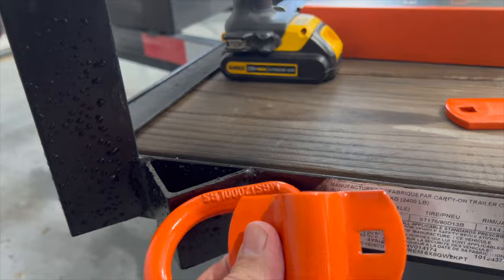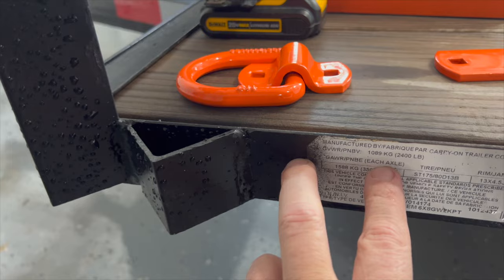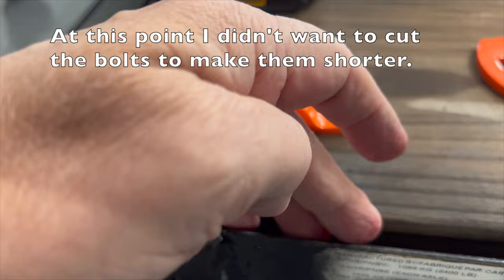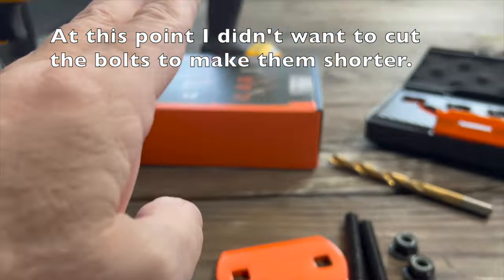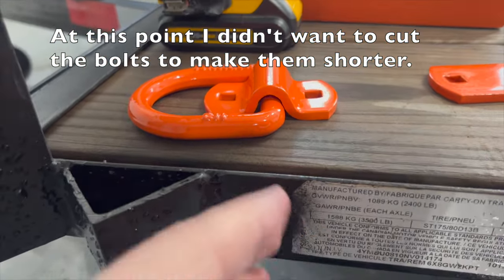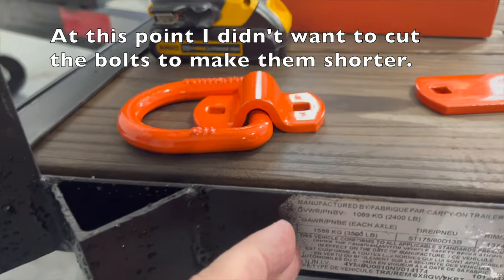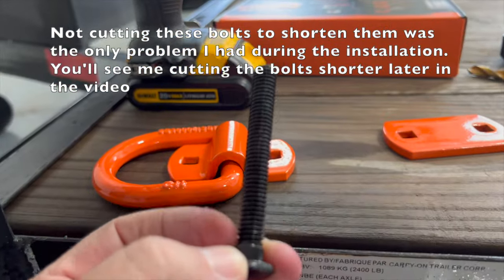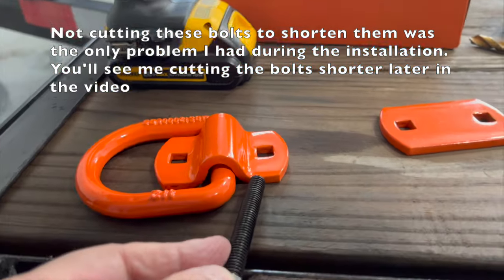Let's get started. So I'm gonna have to put 3/8 inch holes through here, and I know that there's wood right here, so I'm gonna get the long drill bit over here once I get this impact drill through the actual metal. I'll get the long drill bit and drill into the wood a little bit. That way there'll be room for this 2, I think 2.5 inch bolt to go through, because it's gonna go in there pretty far.